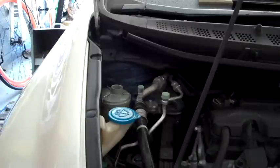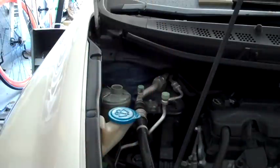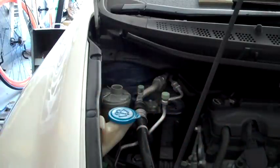At this point I'm going to put the car up on the jack, put it on a jack stand, get the wheel off, and see if I can gain access to the power steering pump. Another thing you want to do is remove the serpentine belt before you jack the car up — it's a lot easier to do on the ground. I've got another video on how to do that using regular tools without buying a special tool. I'll put the link right here.